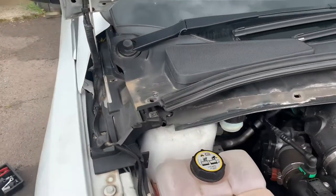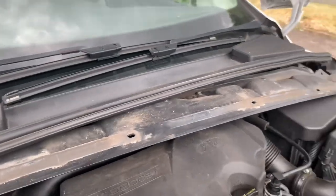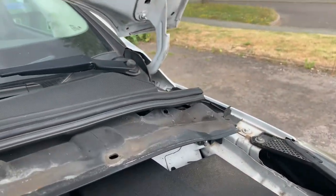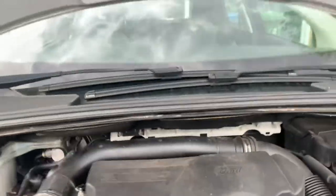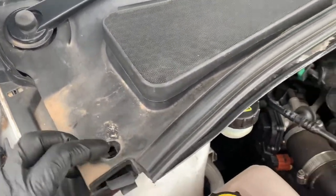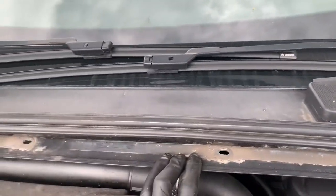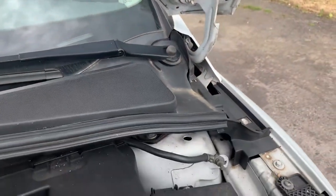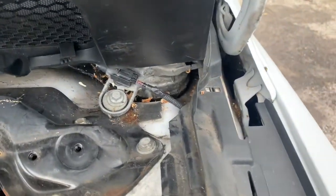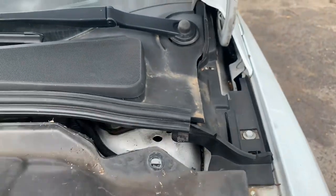Now after you release the knuckle from the suspension strut, there is a piece of trim you have to remove — basically there's this under-tray in here which I've already removed earlier on. It's very simple: you have a Torx screw around here, I think it is number 25 or 30 — you just unscrew that, there's one on each side. Then there are about four pop rivets you just pop up, and also a number 10 screw in here — you just remove it and then take the tray off.